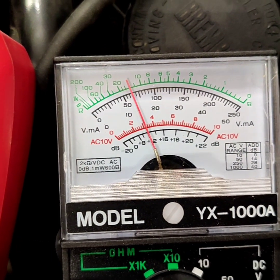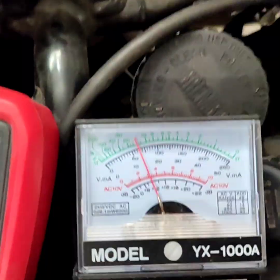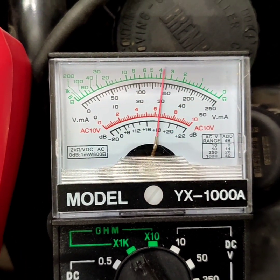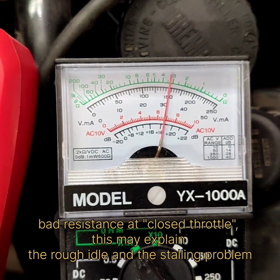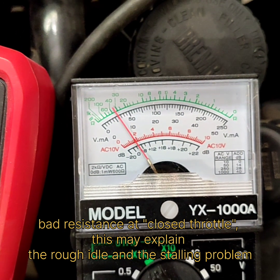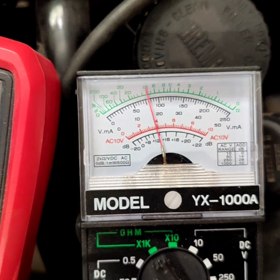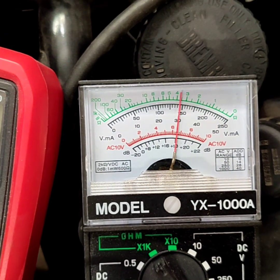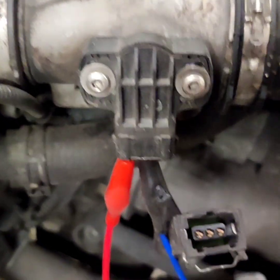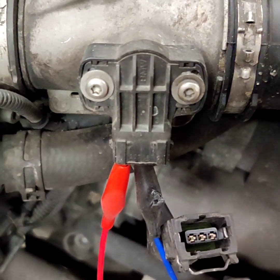So I should be at idle, and the resistance is very, very large. And if I open the throttle very slowly, you see what happens? Maybe I'm at 10% of the throttle, I release it again, pull the throttle a little bit — the resistance becomes quite infinite and then decreases. So it looks like the TPS sensor is damaged at the very low end of the throttle position.